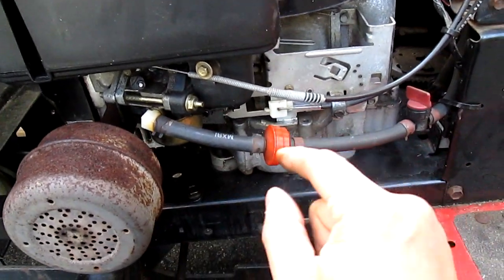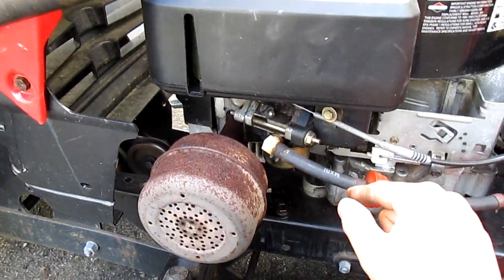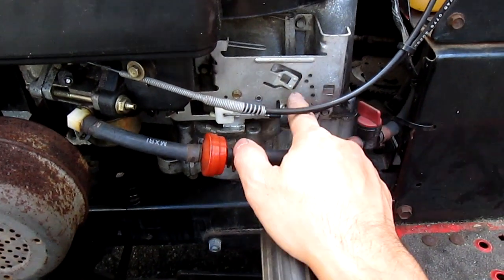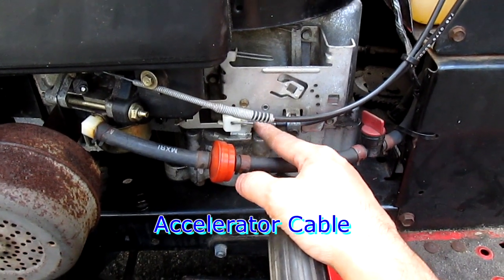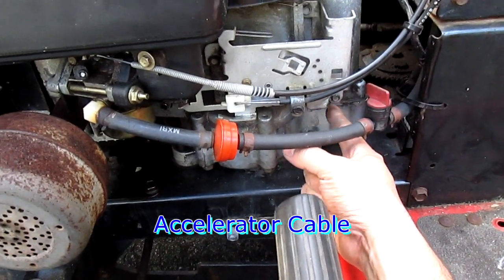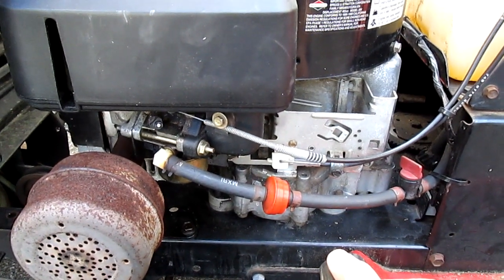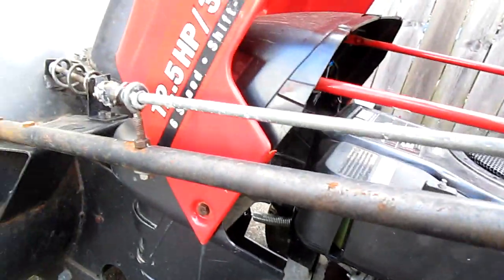You don't really need to do much. Make sure your gas line is clear, spray your carb, and check your choke line and throttle control — which is controlled by the governor right here. Make sure no grass or debris is stuck around there; that's a spot I always clean. And every year just dump the old oil and put fresh oil in rather than waiting — that's the only maintenance I do, and this mower sits out in rain and snow.